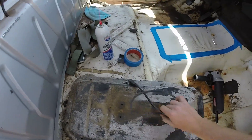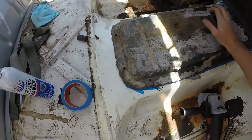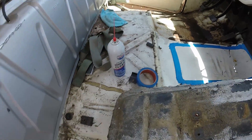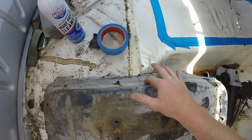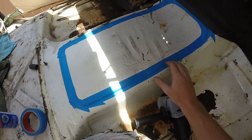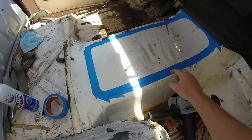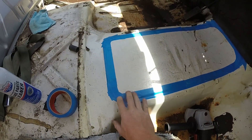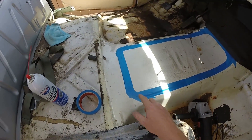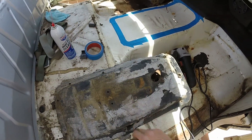What I did was take this hump from a floor-shifting truck and put it kind of in place. I'm not going to use this one — it's really beat up, I'll get another one. I measured in and it's about an inch and a quarter to an inch and a third from the edge. I pretty much just took tape, went around it, went an inch and a third in, and went all the way around. Then I'm going to cut on that line instead of the seam, just a little bit further in, and then everything will fit. We'll cut that, mock up the trans, and see where we need to go from there.